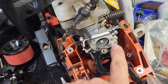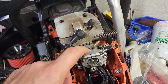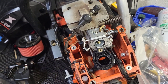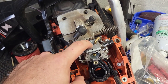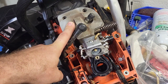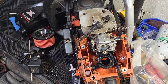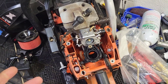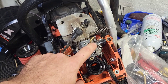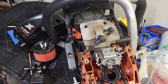If you have a vacuum leak somewhere on the rest of the saw, your fuel line will not go empty. It may cause the saw to run lean, like you've got your fuel adjusted wrong. But because there are check valves — one-way valves — in the carburetor, your fuel line should never go empty. So if your fuel line goes empty and your tank is full, the issue is a valve in the carburetor, not a leak in the rest of the saw. The way I verified that was a carb swap — I had a saw with the same carburetor. Fuel line went empty, there's a one-way valve in there, and you shouldn't have air flowing backwards through the carburetor. That's not good. That's the whole reason this saw had problems.